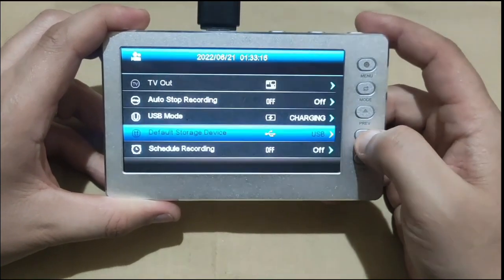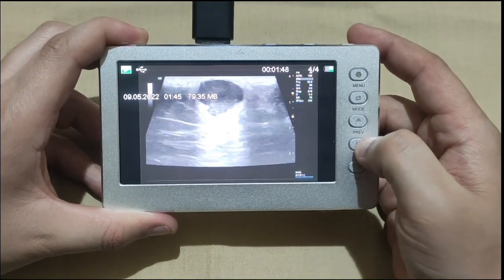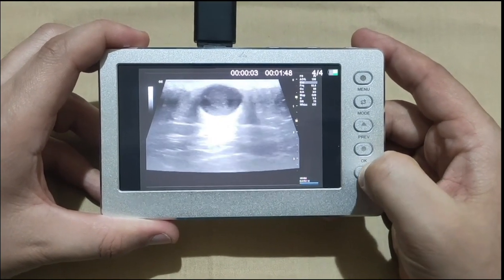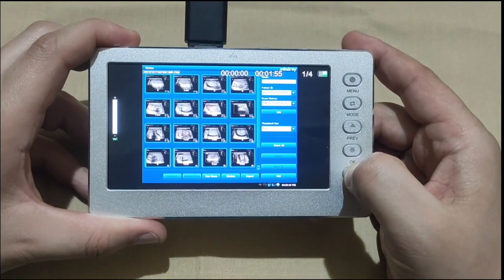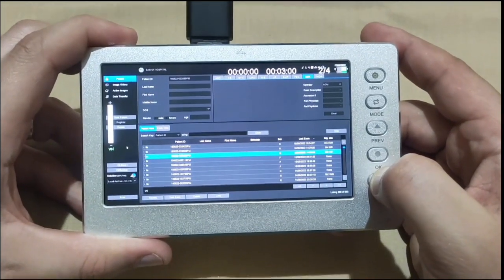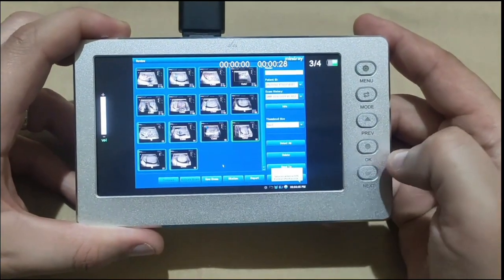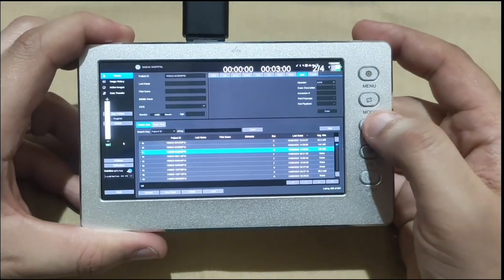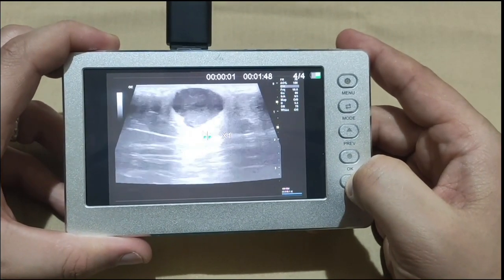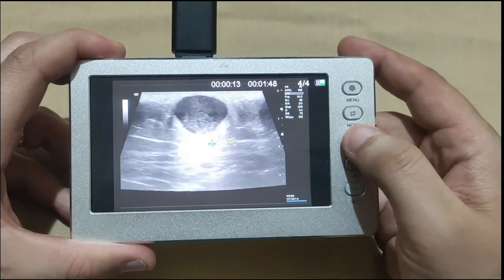To play recorded video, press on Mode button to switch to the play mode. Then press on OK to start playing video, and press on OK again to pause video. Press on Next button to switch to the next video. And press on Previous button to switch to last video. To fast forward or fast backward the playing video, you can long press the previous or next buttons.